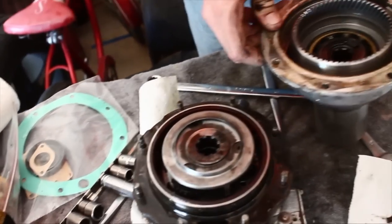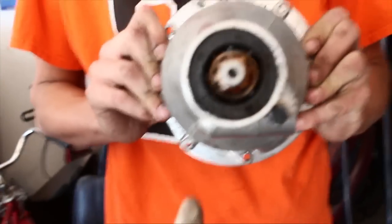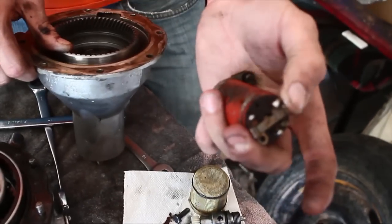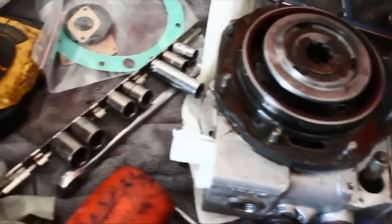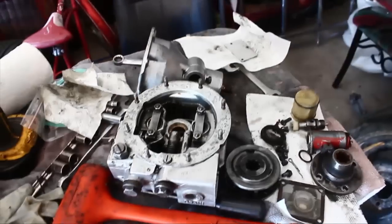Hopefully our housing looks good. There's an oil seal back here — that's in the kit. Then we have our overdrive seal. We've got to clean the screen filter. There's a rubber ring — actually it looks like three rubber rings — that we need, though we didn't get one of those. What other seals do we have? We've got a drain plug, copper O-rings, a couple of O-rings, a gasket for right there, and another gasket here that's got the small 8mm bolt. Does this look better or worse than that M41 rebuild? I'm going to say better — I'm having more fun.